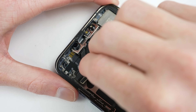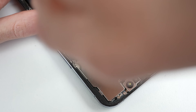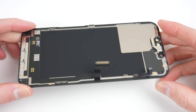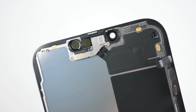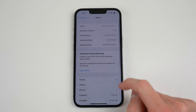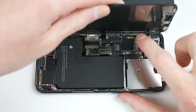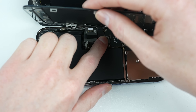I'll first reinstall the original front camera to ensure accurate test results. After reinstalling the logic board back into the phone, it's now time to test out a display replacement. This screen has two cables — one for the display and one for some sensors at the top. In previous models, this cable is paired to the phone and replacing it will break Face ID. The first screen I'll be testing is straight from the gold iPhone with its very own sensor cable. As you can see, we're getting that important display message which I expected. In display and brightness, True Tone is missing and Face ID no longer works. For my next test, I'll attach the original display's sensor cable and the other phone's screen cable — this way I don't have to physically remove the sensor cable, meaning it remains untouched.